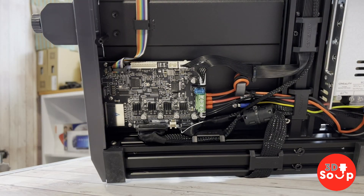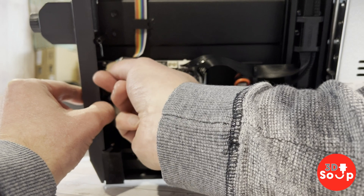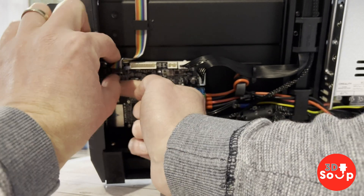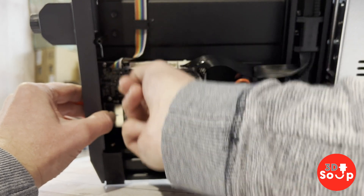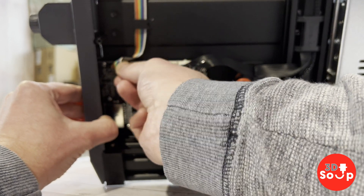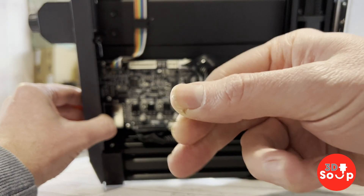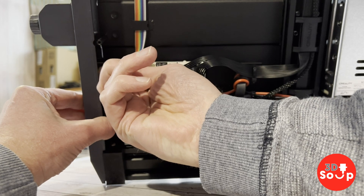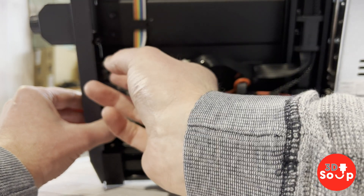Here's a quick look at the board itself. I'd recommend taking a picture of the board before you start work, just so you know where all the cables go. Now, if you've watched the how-to video on the Creality website, you'll see them pop these connectors out really easily with no problem. What they don't show you is that on yours, they will have hot-glued every one of these in to make sure they don't pop out during shipping. Hot glue is an absolute nightmare because it gets into all the little cracks and holds the cables in fast. Be very careful when taking these out so you don't tear the cables from the plugs. Always pull the plug and never pull the cable — if you pull the cable you're going to tear it and may have to re-solder, or you may have broken your printer.